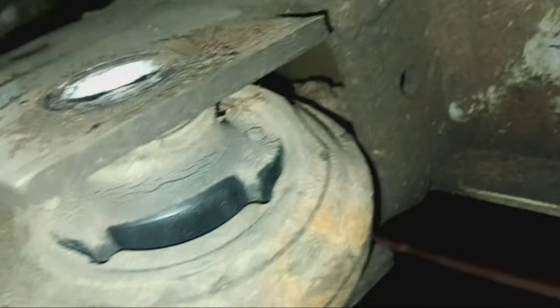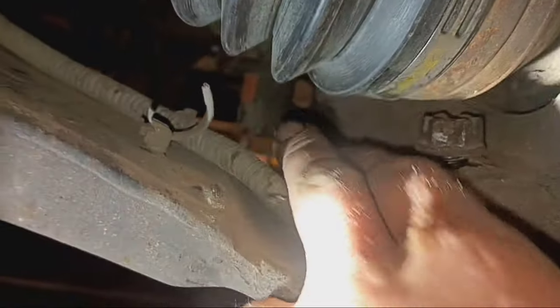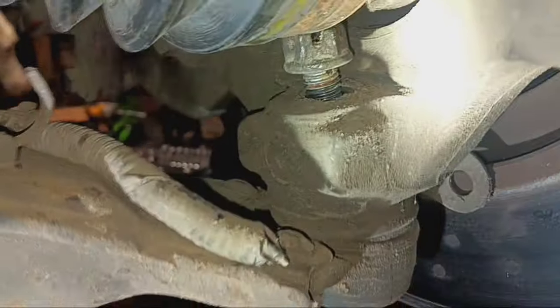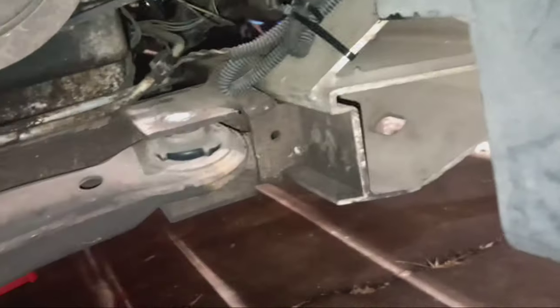I noticed it — it's cracked right here, which is probably what's been making it move. I got my bolts out and I've got the nut on the ball joint loose. I need to loosen it until it hits the CV axle like I did on my mom's car — the nut won't come out because it's still threaded on. Now I've got to get the pickle fork, slide it in here, hammer it down, and it'll pop it off to where the nut hits the knuckle. Then I can finish taking the nut off and this thing will slide right out.